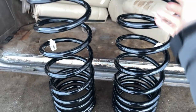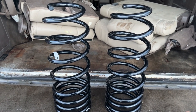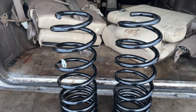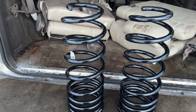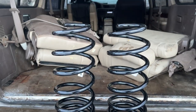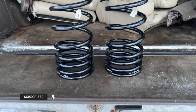When installing your rear coils, make sure you check which side is which. You can always verify by taking out your old coils — usually your driver's side coil is slightly taller. You can't really tell the difference by eye, but if you measure it you can see it, and here it was only half an inch.